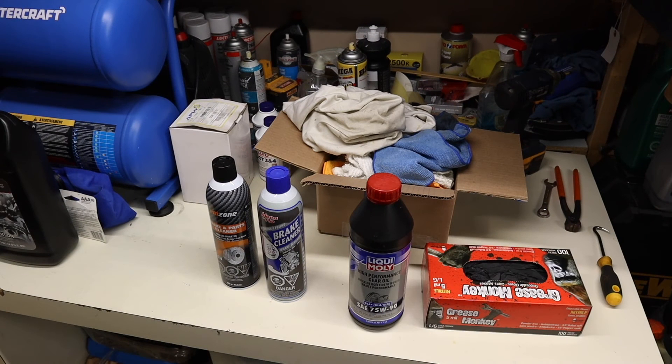I'm going to give the shop a generic 75/90, like this Liqui Moly stuff, for the rear diff. This is not to be mixed up with the Haldex fluid, which is a friction promoter, so make sure if you're working on the rear diff you're using the right oil. A generic 80/90 or 75/90 can also be used in the transmission or the angle gear on these cars.